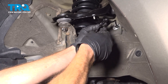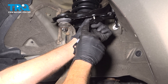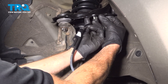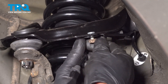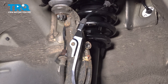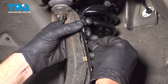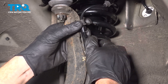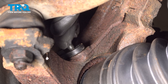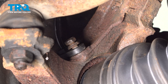Continue on to bringing it across the upper control arm. As you bring it up, you have the mounting hole and also an alignment tab at the far end. In the control arm, you should have a small hole where that will fit into. Secure your ABS wire bracket to the steering knuckle. Slide the sensor right into the steering knuckle, align the mounting bolt hole, and start the bolt in by hand so you're sure you are not cross-threading it. Snug it up and then torque that to 7.2 foot-pounds.